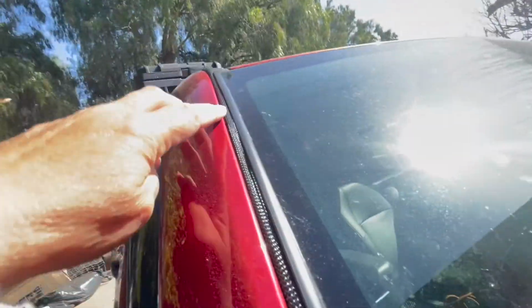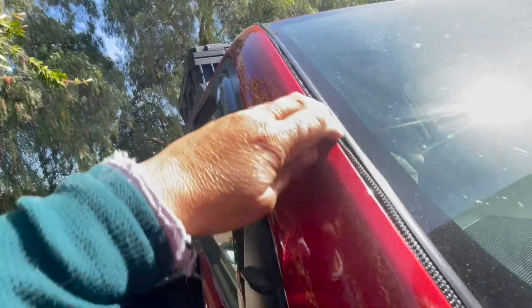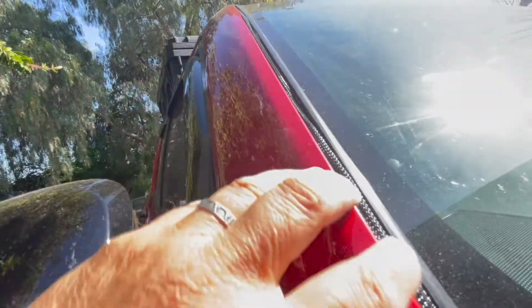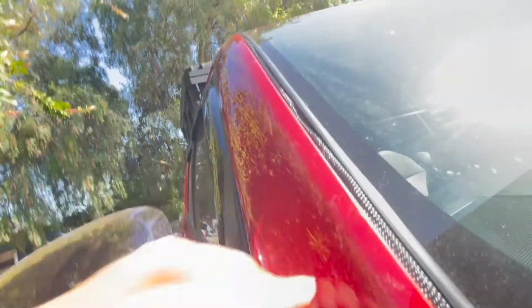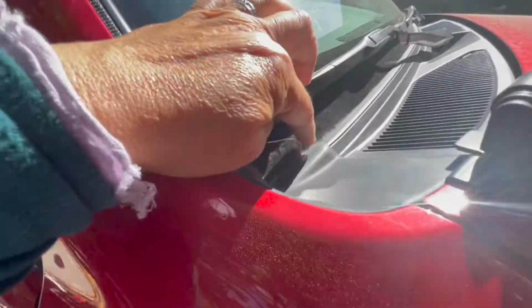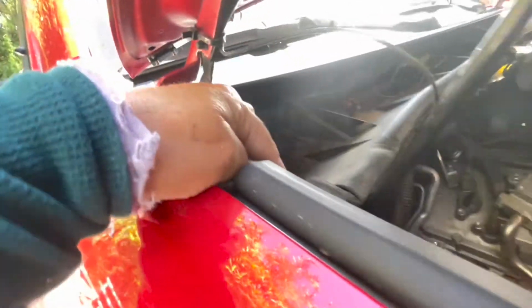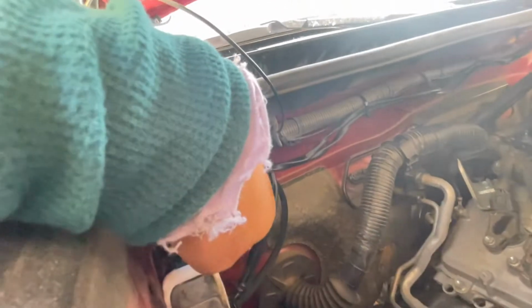And then I pressed it into the drain on the windshield using some of the plastic body mount kit tool. So I pressed that in, and then I ran that extension wire I had created into the engine. You can pop out that little plastic piece, and then I ran it through and then up and around, and then the harness runs across.